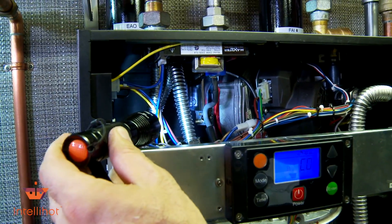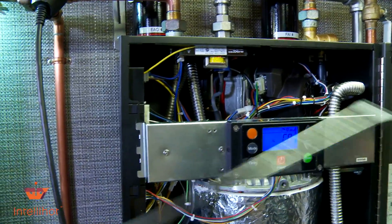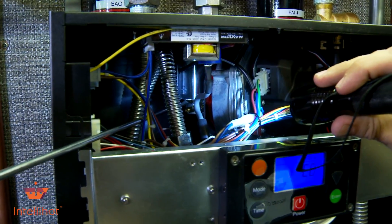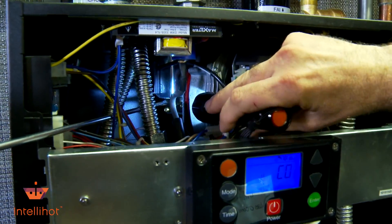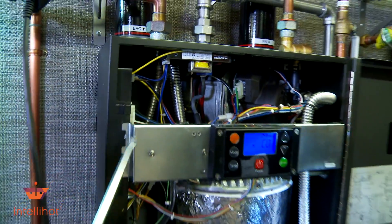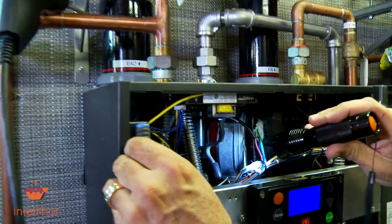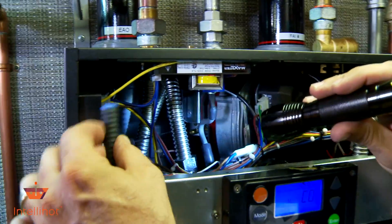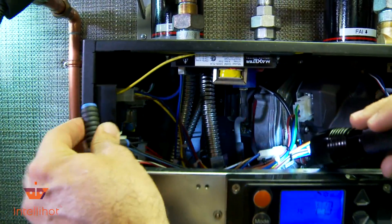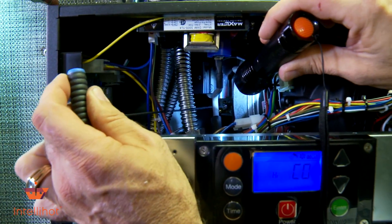If you're going to do this, you really ought to get the tools to make your life easier. I have a little screwdriver — it's pretty long — and basically I just go behind all of the electronics to that upper port right there so I can make my adjustments, whether it be high or low. You can see I am underneath that black silver bracket with the black gas valve harness connection. That's our high fire. For the low fire, I go behind all that again — there's not a lot of room — so you could actually utilize a smaller one, or just pop this out and let it hang down out of your way. That little one right there in the front is the one you would adjust.